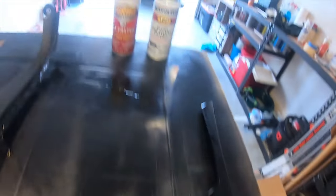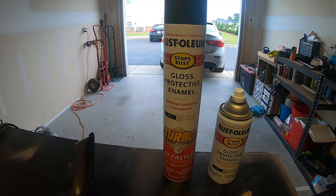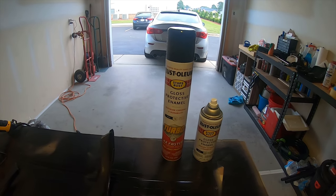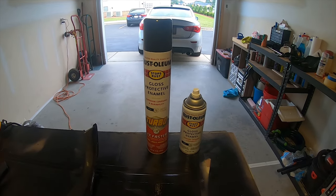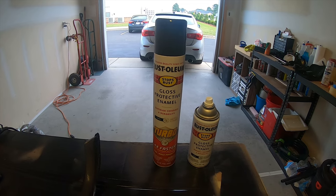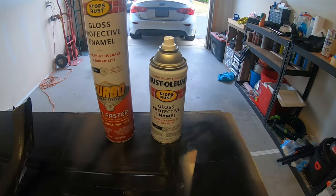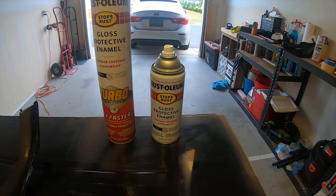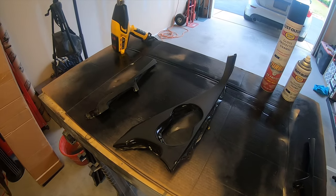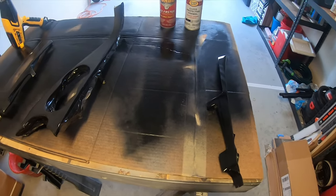To get the finish, I went and bought a smaller can of the same turbo paint so that way I had a little more control — I didn't have that 10-inch-wide fan to deal with and all that back pressure. Now if you're painting a large panel like a fender, a hood, diffuser, or side splitters, by all means get the turbo can — it'll completely cover the area in two passes easy. But for these small pieces, go with a small can. It's easier to manage and just overall a better option. So I'm going to go ahead and finish cleaning these two pieces off, get them sprayed so they look like the third one, and I'll bring you back when all three pieces are nice and shiny.